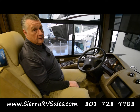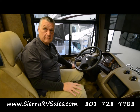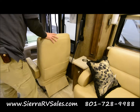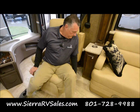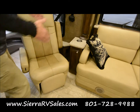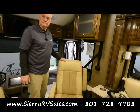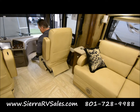Remember, the engine has to be running to lower the levelers, but it needs to be in the on position without the engine running to let the slides out. When you get ready to pull back in the slides, make sure that this chair especially is leaned back. This chair can come all the way back and it also revolves — this chair turns around like this and you've been using it to visit. Now when it's time to go and you're going to pull in that slide, do you see that slide? It's going to come in on this chair. So make sure that these chairs are in the face-forward position before you pull in the slides — otherwise it's going to break something.